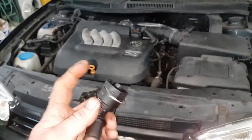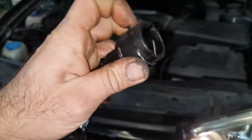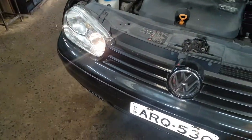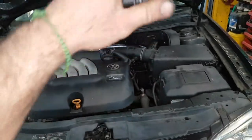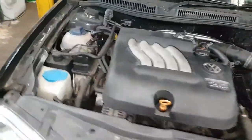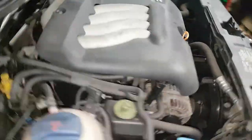They're not always easy to remove, but if you pull the clip off by just taking it off one side — so when you're pulling it out, just get one side and the clip will come off. Unless you want to keep that clip, or you're worried — that's fine. But whenever touching this, the clip's going to jump back on. That's the number one thing. Number two: always have your heater on when bleeding and purging the coolant, refill it slowly.